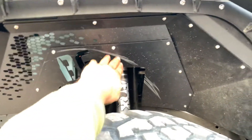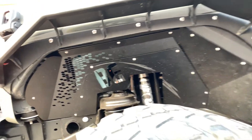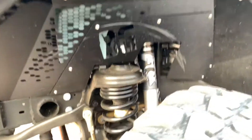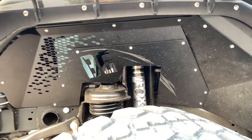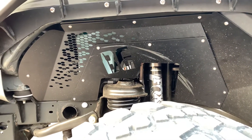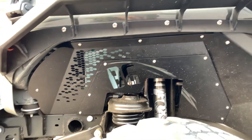You can see here we've already rubbed a little bit. Right now this is a Metal Cloak 3.5 running 17s, so we may have to adjust the bump stops. First time out on the trail, we already rubbed them and scuffed them up. But, like I said, the instructions left a lot to be desired.